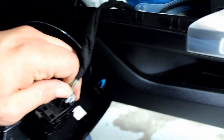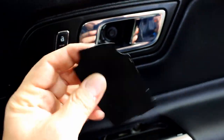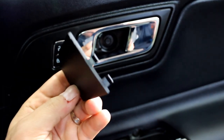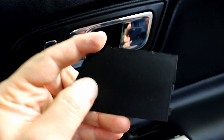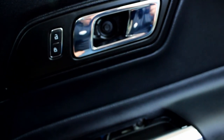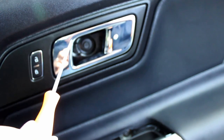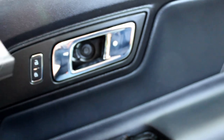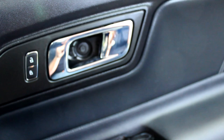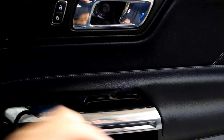There's a bolt behind the handle. To get behind there, you have this plate — it has one little plug and it hooks on the inside. Push it in and there's a little cutout right there. Use a pick — something with an angle on it — go in the top into that groove and then pop it out. Remove these two 10mm bolts.